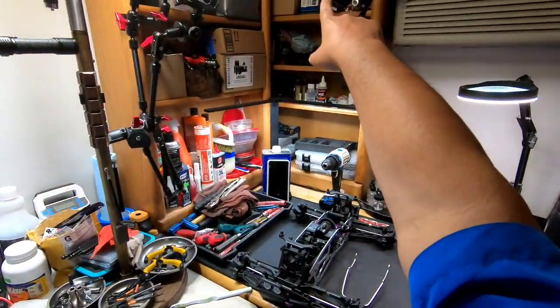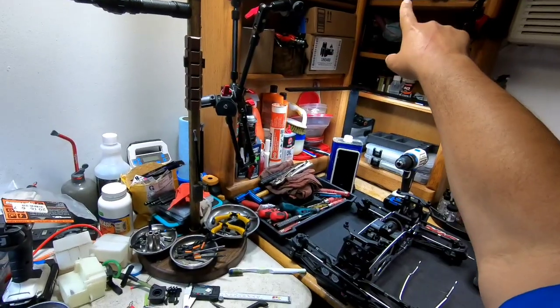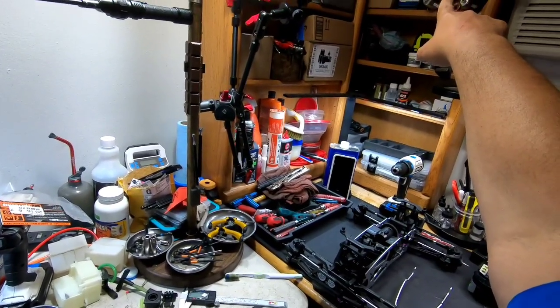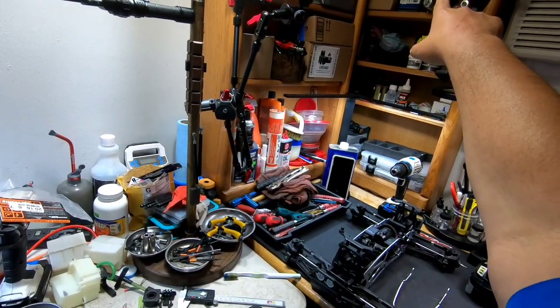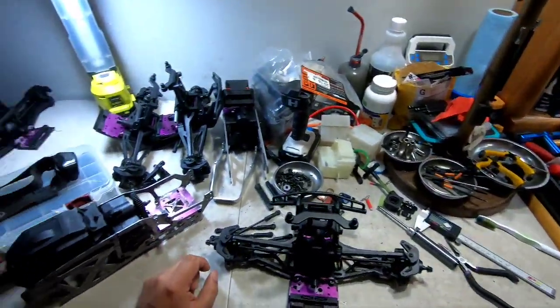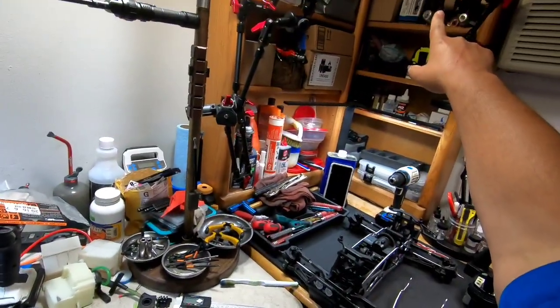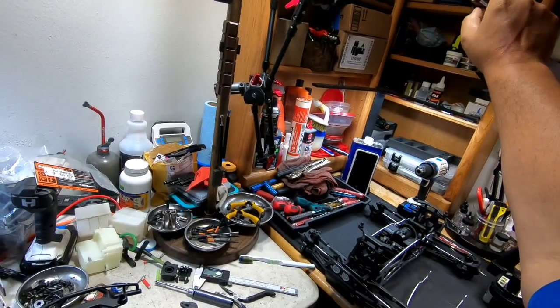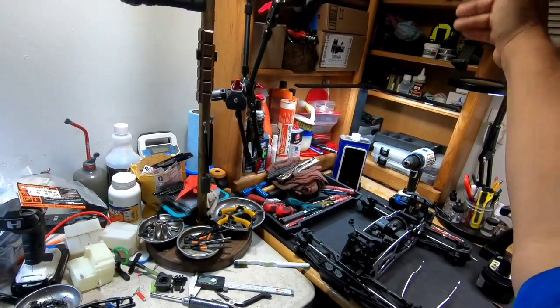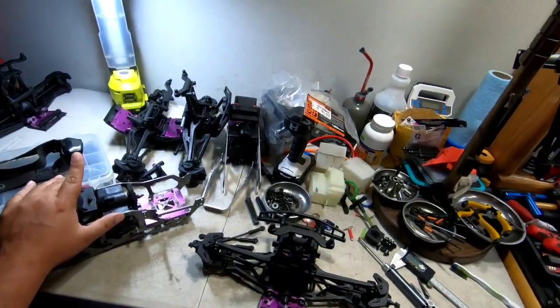putting the HPI OG 25 I have up there. Not either one of the 28s, not the K or the F series 28s, but the 25 I have with the oversized nut cooling head on it. The big purple nut cooling head right there. That one is a 25. Think about sticking that in him. Or hear me out, put the F series, which is my favorite, the 2-needle carb, or even the K series, the 3-needle carb, either one of those 28s in him, the 4.6, because he's going to need power for what he's going to be used for, like all the rest of them.